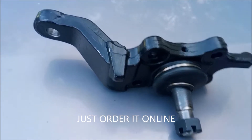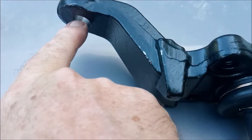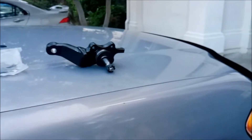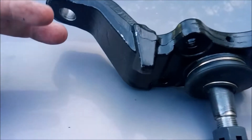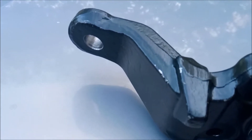We're going to have problems right here where the tie rod goes in. I have a fork in there because they say you can hammer it and it'll break loose — well, mine didn't. So I got a pickle fork and I actually had to cut the end of the pickle fork off on the two forks because as they went in, they were hitting. I had to shorten those, and I've been hammering the hell out of it and still can't get it to break loose.